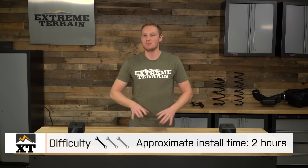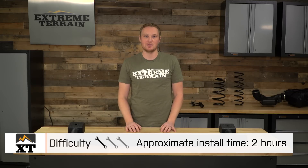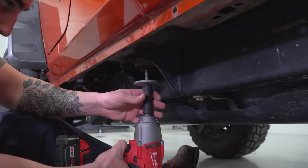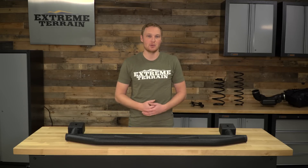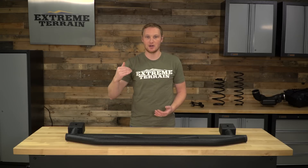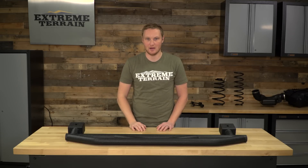This is a very simple one out of three wrench install that you can get done in under two hours for the pair. All you need to do to get these installed on your Jeep is to remove the body bolts that are under the rocker. On the two-door, you'll have two; on the four-door, you will have three. You can spray those with good penetrating oil beforehand, but it is a little tough to get up onto the top side of those bolts where the threads are. Just be careful — use a large breaker bar and you should be able to remove those without a problem.